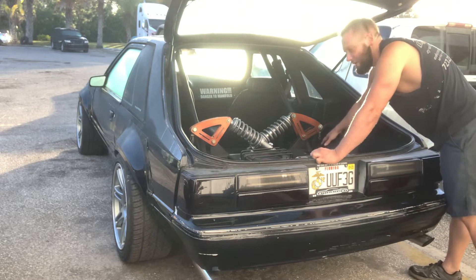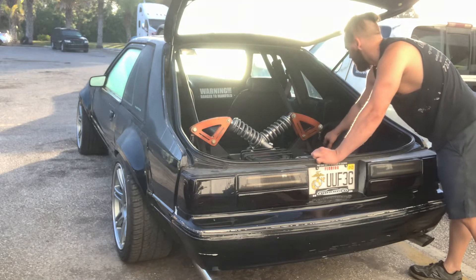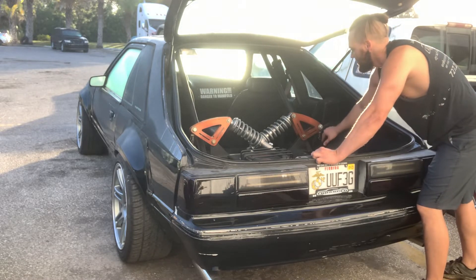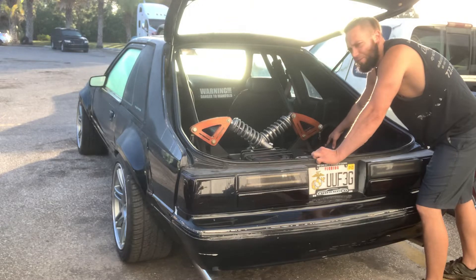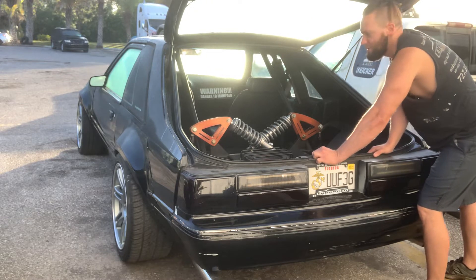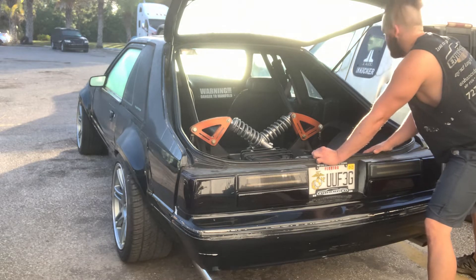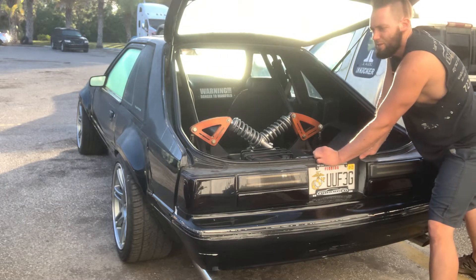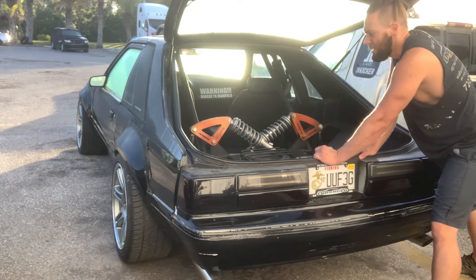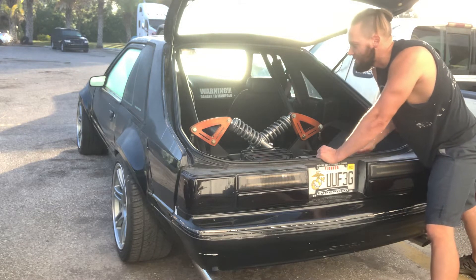To mount these up top, I drilled out where the original top shock mount was. A lot of times coilovers mount there and you really have to stiffen that area because it can rip out from the body — they're not really meant to hold the weight of the vehicle. I originally had coilovers in there for about a year. After seeing an IRS setup I thought this would be cool. I didn't invent it — Adamvon Geting Jr.'s 1969 Mustang had it and that inspired me. A lot of off-road racers use this style too — it goes back a long time. You're really just transferring the movement, so I thought about going up the cage with it as well.